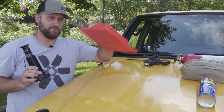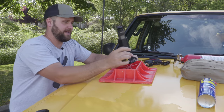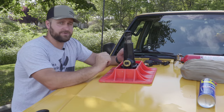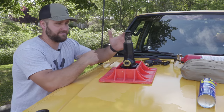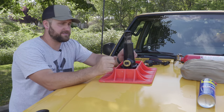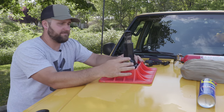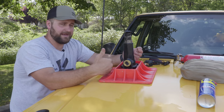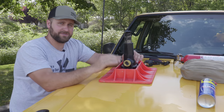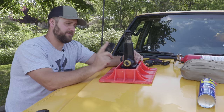This is a high lift off-road base, which works for the high lift, which I also carry. I recommend having an off-road jack like that. This is just your basic vehicle jack that comes in an XJ. I don't like the scissor jacks — you get those twisted just a little bit and they can collapse really easily. These are pretty sturdy, easy to operate, and they go underneath your axle tube. This isn't something you'd try to lift all the way to your rocker, but it's perfect for just getting a tire off enough to change it easily.